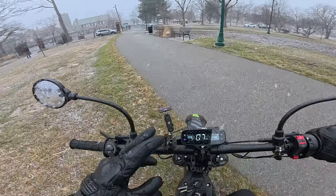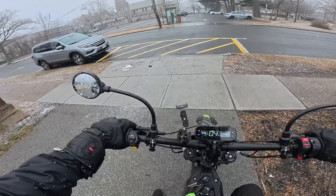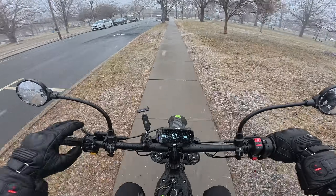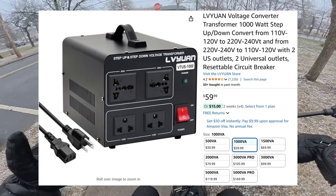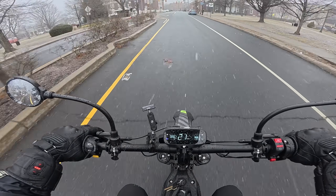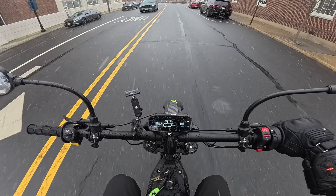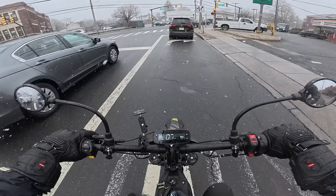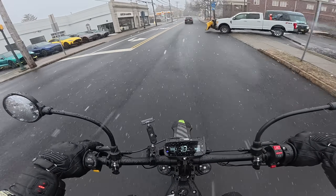There are two other things worth knowing. If your charger only accepts 120 volts, you can get a voltage step-down adapter that converts 240 volts down to 120 volts. This device is really cool and in theory lets you run anything off a public level 2 EV charger. Unfortunately it's kind of big, so it may not be super practical to carry with you, but it does exist. You can also get the same adapter I have but for the Tesla charging standard — I'll leave a link below the video if I find one.